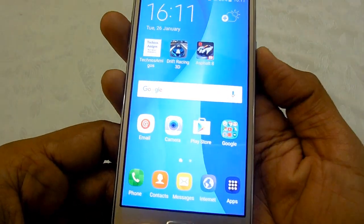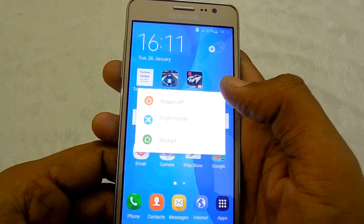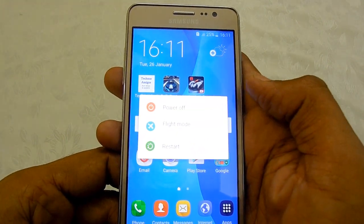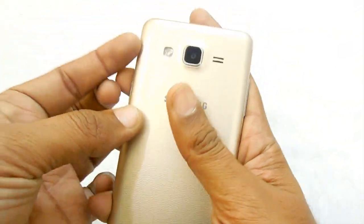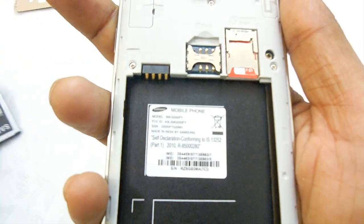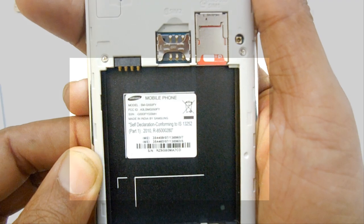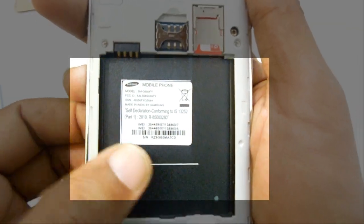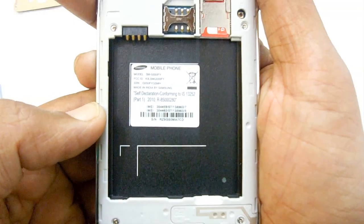The third way is to turn off the device and just below the battery on the handset there will be an IMEI number behind the back cover. The phone has been turned off, and here most of the manufacturers write the IMEI number. There I have the IMEI number just above the barcodes, followed by the serial number.